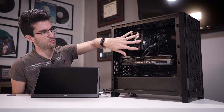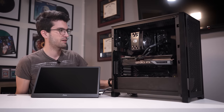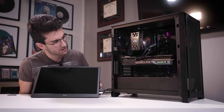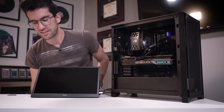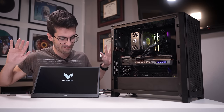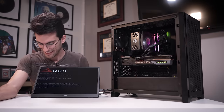We've got his CPU cooler, or the fan, sorry, on the correct side this time. I still want to tackle cable management after this, and I also want to add a little something to help spruce up the airflow a bit. It looks good so far. Yep, amber DRAM light is off. We should be getting a post. There it is. That's it. A freaking BIOS. Piece of cake.